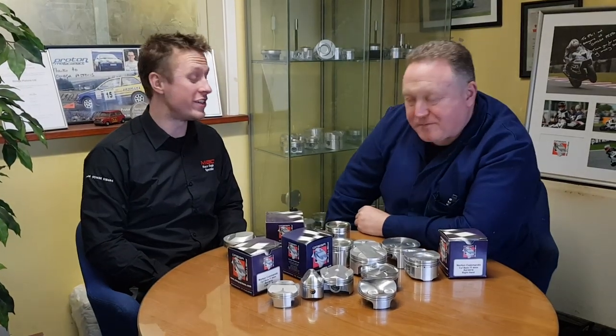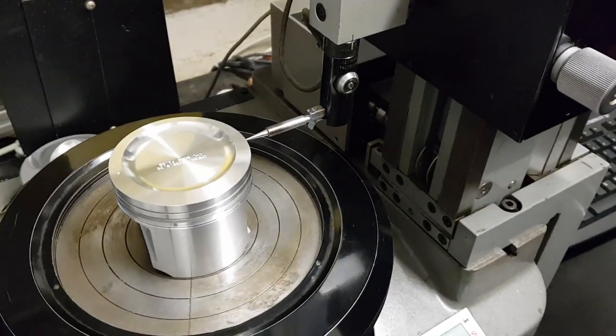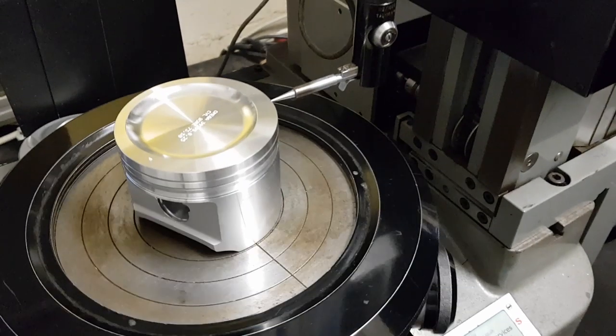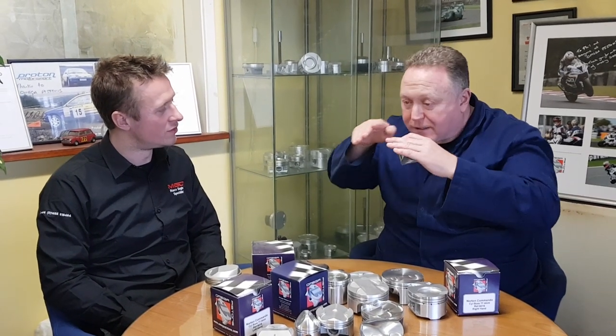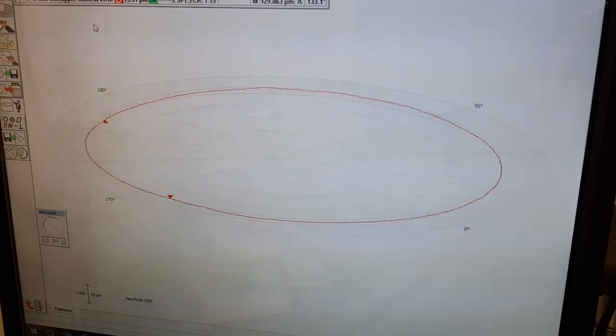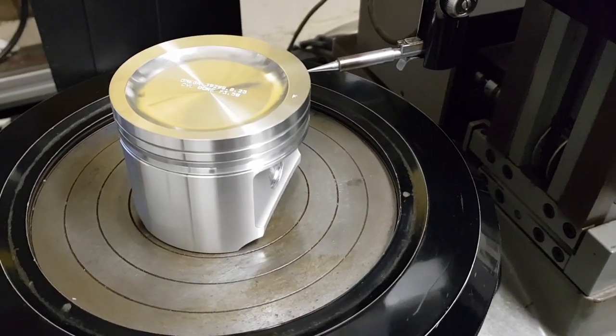One thing I haven't mentioned yet is the piston ring grooves. We've got footage here of a cool tool to make sure that's flat. How vital is it that the piston ring sits flat? It's extremely vital, particularly on the top ring — that one has to seal. If you've got any unevenness on the flatness of the ring groove, the ring won't be able to conform and seal properly because it'll have gaps underneath it. We don't allow any more than three or four microns all the way around, over 360 degrees. That's what makes a big difference on performance pistons — it stops any blow-by. Have you put a standard piston in the gauge? We've put some other manufacturers' pistons in there and it's like looking at a roller coaster.